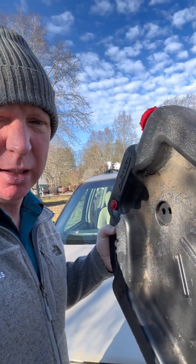Some videos said to drain the radiator — I actually didn't do that. I took a drain pan and put it under when releasing the thermostat — it leaked quite a bit. And when I had to replace the bypass hose, it also leaked a little bit and I had the pan underneath there. So make sure you've got something handy to catch excess coolant dropping out. You can go ahead and drain the radiator, but I chose not to and felt like it was all right. Before the test drive, I checked coolant level and made sure everything was good since it did lose a little bit during the process.